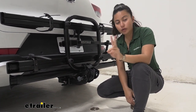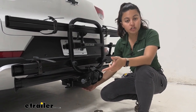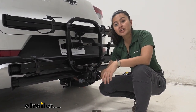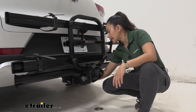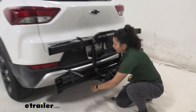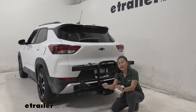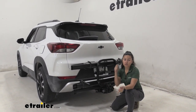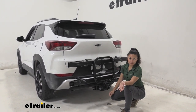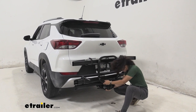Let's talk about the hitch. You have two shank options for this bike rack: a 1.25-inch version or a 2-inch version. I always recommend the 2-inch if you can, especially if you have a 2-inch hitch receiver. The shank tightens down into the receiver using an anti-rattle bolt. The lock shown is not included — instead, you use a cable lock that wraps around your bikes and threads into the anti-rattle bolt to secure both the rack and your bikes. Tighten it down with a 15/16 socket or a 24-millimeter wrench.